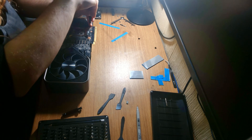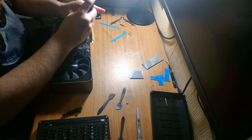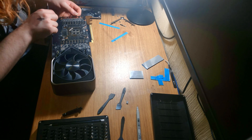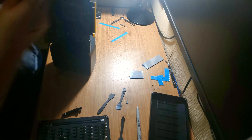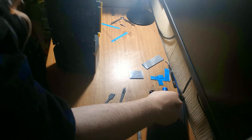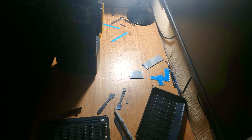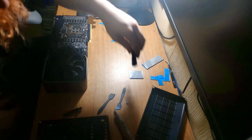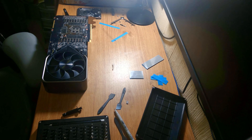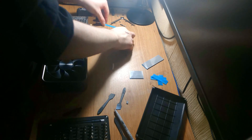We are already now reassembling the card, so we are moving on to the back. With this it gets a bit interesting, because the actual memory on this is what's called a flip chip design — that means the actual die of the memory is closer to the board than it is to the top of the package. That's the reason why you want to go full ham on the back here and get as many thermal pads as you can to essentially coat the entire back side of the card, dumping heat into the back plate.